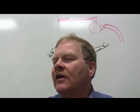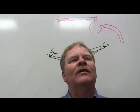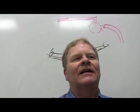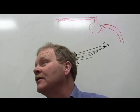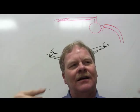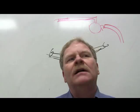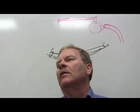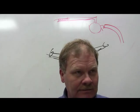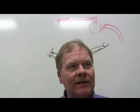The test drive route must also include a stop-start area to check for brake pull, pull-steer, torque-steer, and shock compression and recovery. Torque steer occurs because one CV axle is shorter than the other — the longer one twists more, pulling the car in that direction on acceleration. Something else that affects alignment: if you pull the H-frame out to do a transmission job, since so many steering parts are connected to it, your alignment can be thrown off if the H-frame isn't put back exactly where it was.